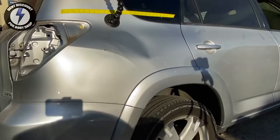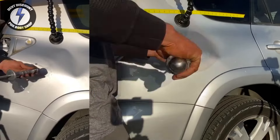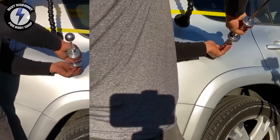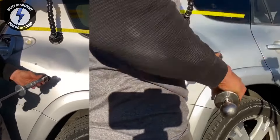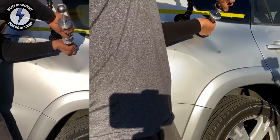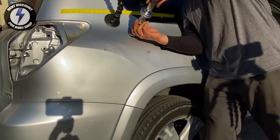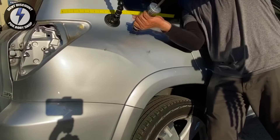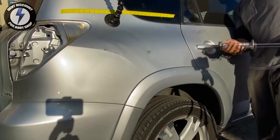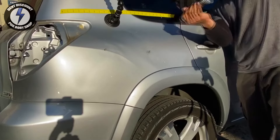After I torch the putty, I'm now going after the lows and the remaining low up above. You can see it pulled the remaining sections of the dent. I'm going to bounce around the different sections of the quarter panel, bringing up some more lows. And you can see that quarter panel — 90% of that dent is gone using hot glue and cold glue.